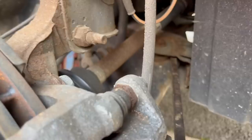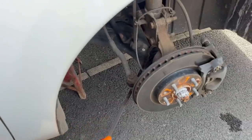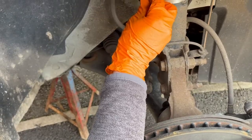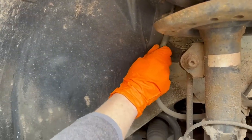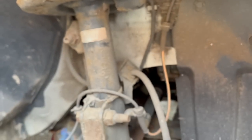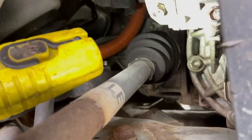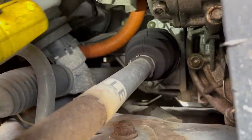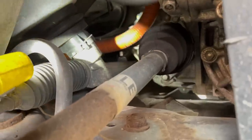Next I'm checking the bottom arm bushes. These do crack and occasionally push through the arm itself. Now I'm looking for lift in the bottom ball joint, play in the track rod end and play in the anti-roll bar drop link — but it's all good. I'm now feeling the coil spring looking for cracks and broken metal, and examining the shock absorber and brake lines looking for signs of leakage. This angle also allows me to inspect the inner CV gaiter, steering rack gaiter and the HV wiring that runs between the traction battery and the PDM — and this all looks good too.